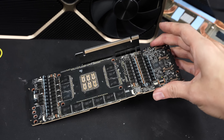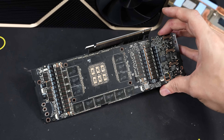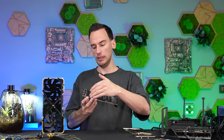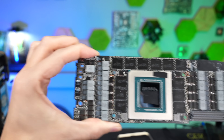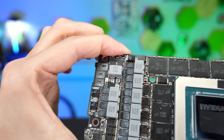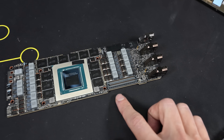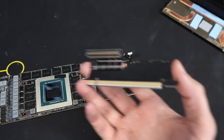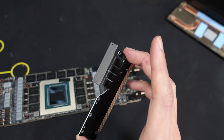To complete this, let's also look at the back side with the card fully removed. You might notice there's no direct 12V high power connector on this card and no big wires that we disconnected — at least not on first sight. The power connection is on the left side where it looks like empty solder connections just left of the big inductor — those three holes are the power connection. I decided to remove the PCIe cable because it was bending back and forth while I was working, which is exactly what I wanted to avoid, so it made more sense to securely remove it.